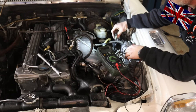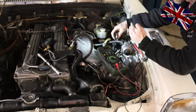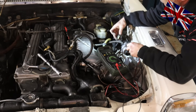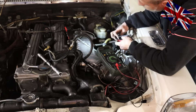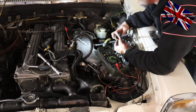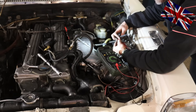The MAP is back in place. Before reconnecting it to the wires, let me check if there is current in the wires. Ignition is at position number two. We start at the left-hand side: mass goes to terminal 15, and plus to terminal 10. At the connecting socket it shows current on the display — no broken wire, and no rodent doing damage by biting wires under the hood.